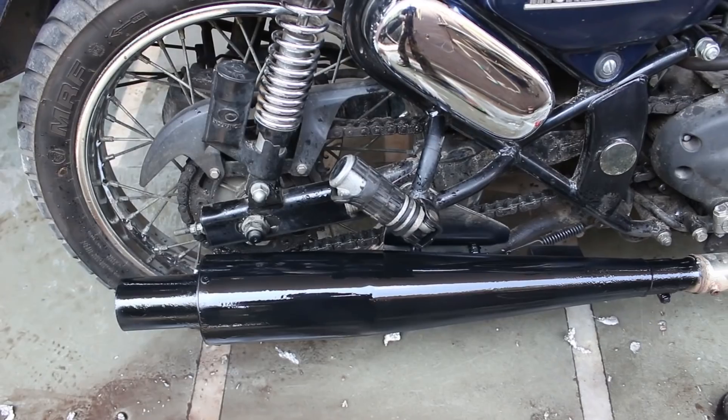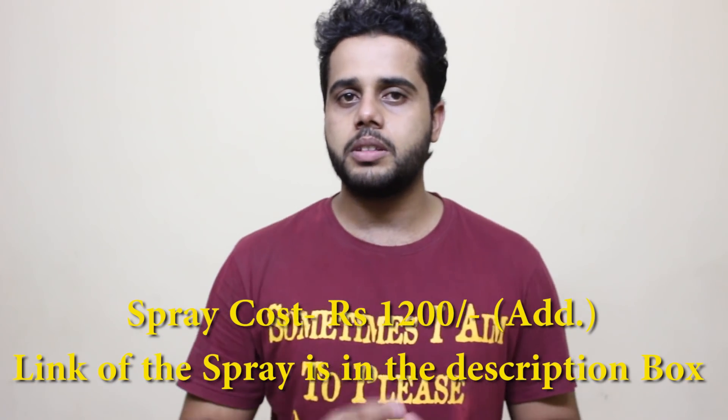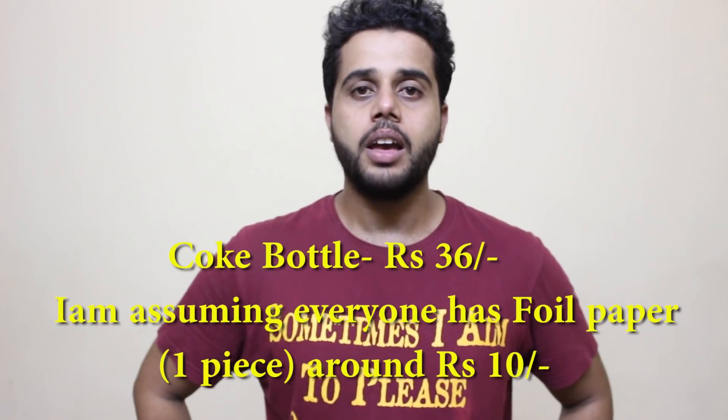So this was the whole process. Now you have seen how I applied this to remove the rust from my bike. Most of the rust was on the silencer. I have a matte finish black silencer so I used the spray — if you don't have a matte finish black silencer, you don't need to use the spray, so your cost will be under 50 rupees. Apply this process and 70–80% of the rust will go out from the metal parts. You don't need to worry about scratching the bike with aluminium foil.